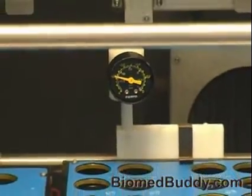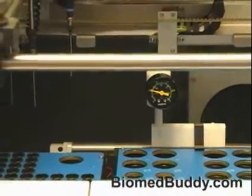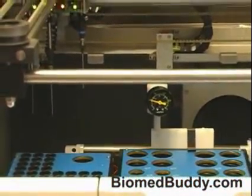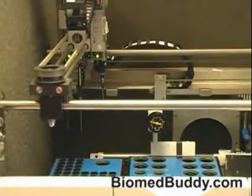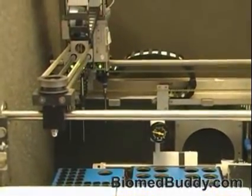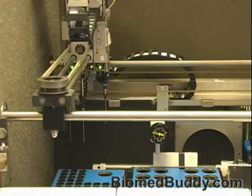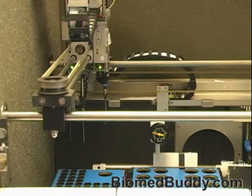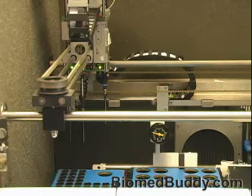Now through the service maintenance fluidic circuit I'm going to turn off my vacuum pump. I consider this to be a somewhat important test. When I turn off my vacuum pump, you can see my needle reading does not drift downward — it should not. If it started drifting downward, that would indicate a leak somewhere, usually in the EV valve but it could be in the tubing. As you can see, that's steady — and that's as it should be.